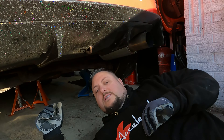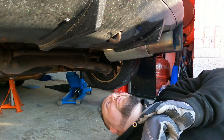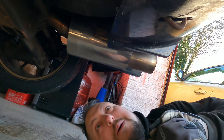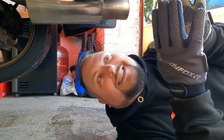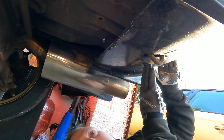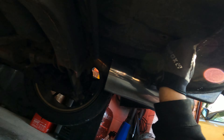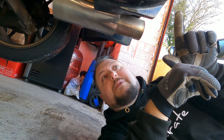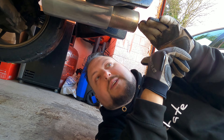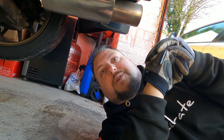As you can see we've got what looks like a diffuser here, but don't be fooled - it's actually quite the opposite. The problem is parachuting. Parachuting basically means it's catching all the air and slowing the car down. These cars are not known for torque as everyone knows. The rear of the bumper scoops down, catching all the air, getting stuck underneath and creating what's known as a parachute - there's nowhere for the air to be dispersed. This car used to easily do over 145 miles an hour and now struggles around the 130 mark on track.